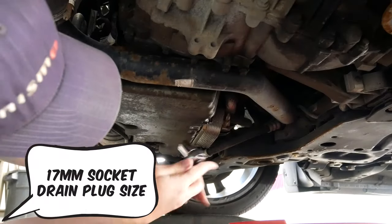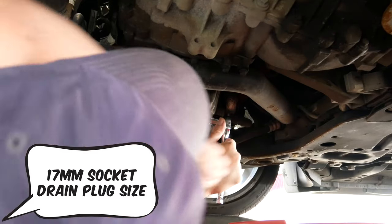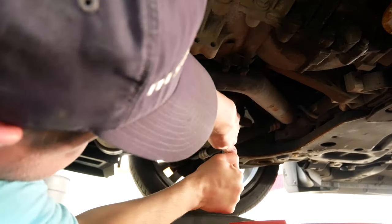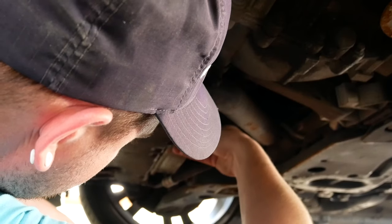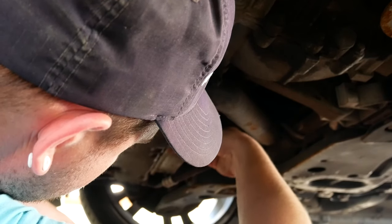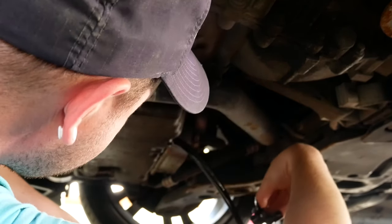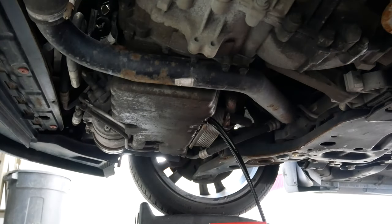The next thing we definitely want to do is get the drain plug off the back of the oil pan. Mine was stuck on pretty hard but I was able to get it loose. Once that bolt has been broken free it's easy to unscrew and let the oil start to drain into an oil pan — make sure you have enough room for all of it because you're draining about six quarts. If you go up to the top of the engine and take off the oil cap it's going to let it drain a little bit quicker. Make sure everything gets out of the engine before continuing.